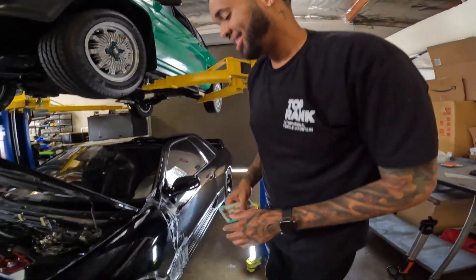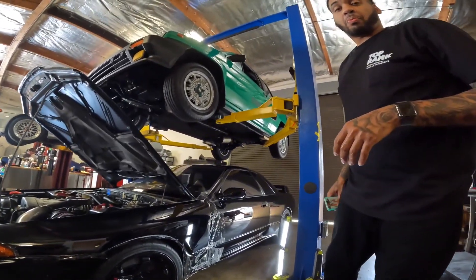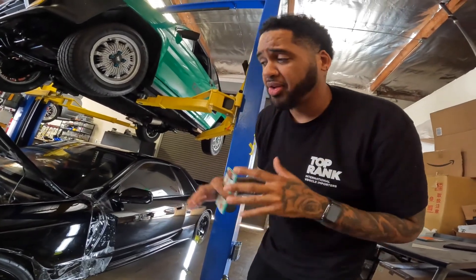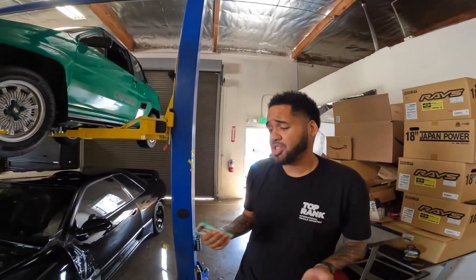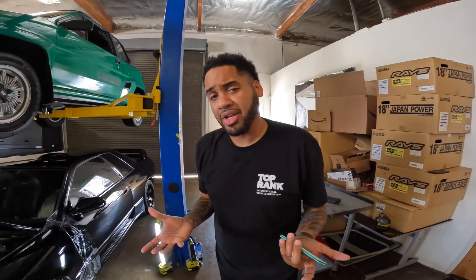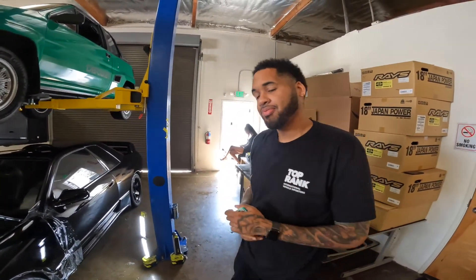We are starting a new day with Mylan Sleets himself. Today we're doing some PPF work — and by we, I mean Mylan — and this is what Mylan does over at Pristine Detail. We do a lot of paint protection film. We got done with the paint correction yesterday, so we're putting on some Xpel paint protection film on the heavy impact areas: the fenders, rear quarter panels, and hood. This film is about 8 mils thick, so it's going to give you some pretty decent protection. If it does incur any scratches, you can literally just heat it out with a heat gun and they disappear. These films typically have an 8-year warranty, so new, used, whatever vehicle you have — paint protection film is always a good investment, especially for the track.